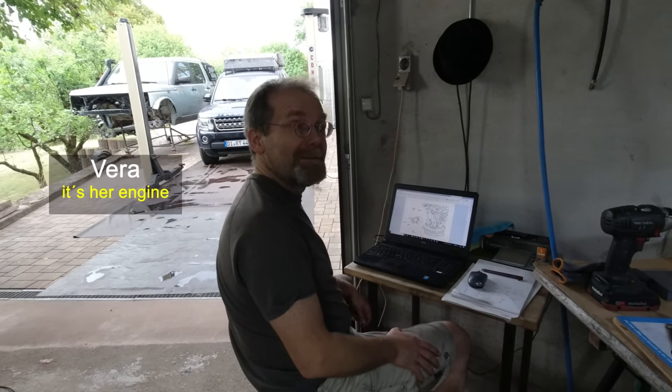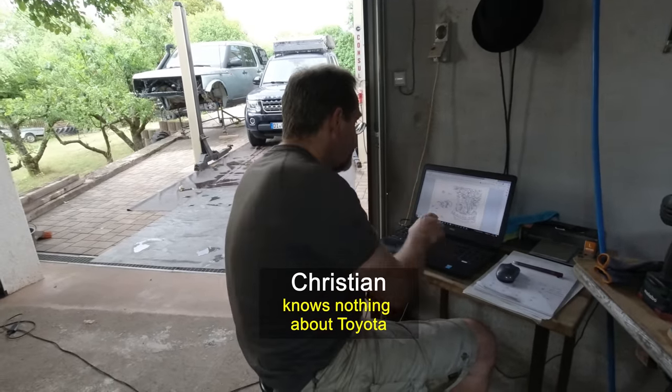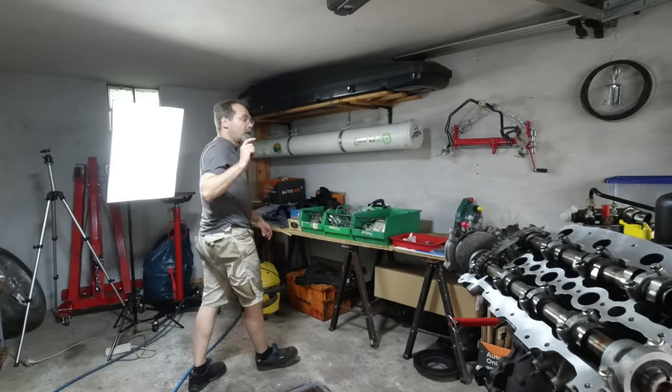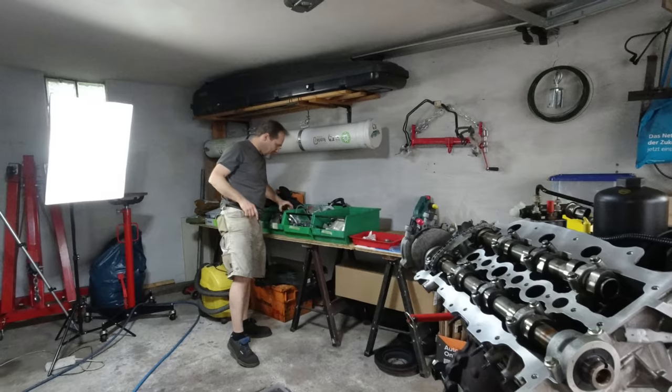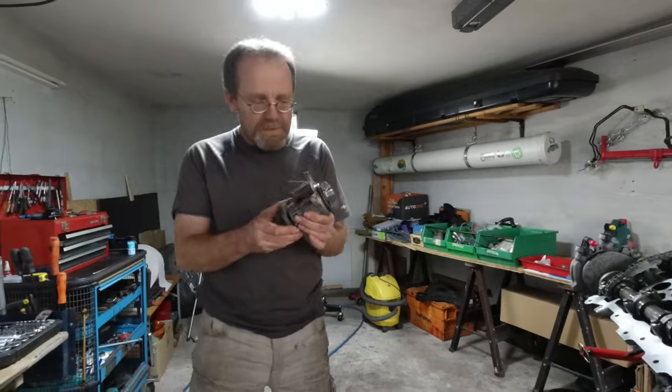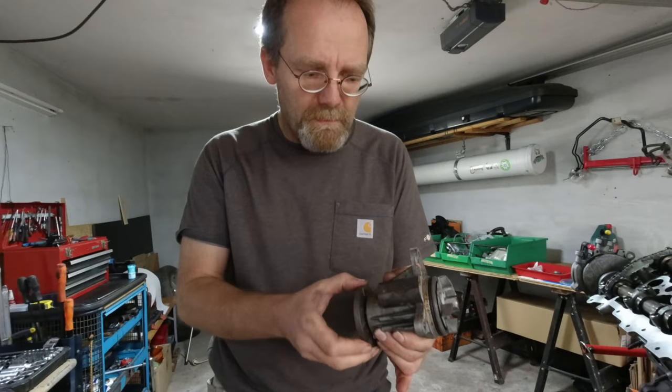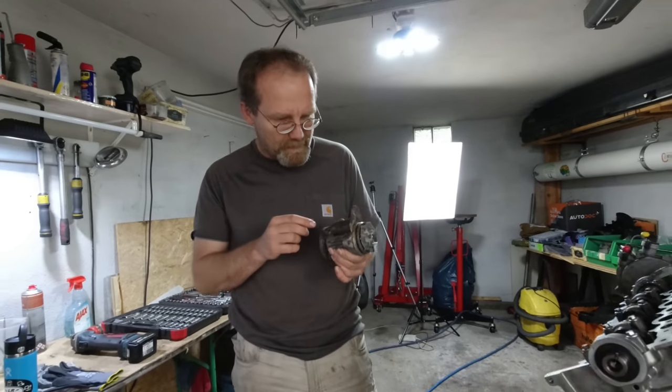It's another day — five days later. We did stuff on other cars in the meantime and I had to work. Next thing is the water pump, which we will not prematurely replace. If this one is still not rattling or having play, plus it has a metal rotor, it's a good one. What am I lecturing about the pump?